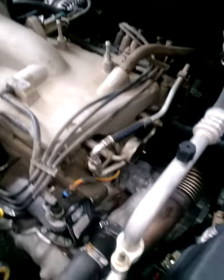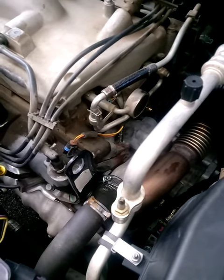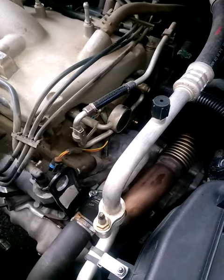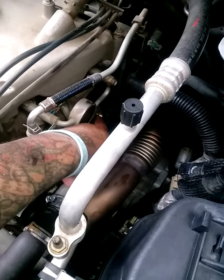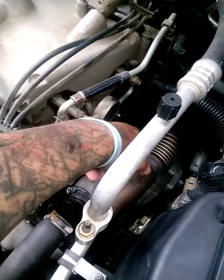The symptom is: when you go through a drive-thru or something the car rides normal while you're driving, sometimes the temperature eases up a little bit but usually goes back down. But when you're in a drive-thru and the temperature just starts to shoot up to where you have to pull out — there's a very good chance that is that sensor right there. Make sure the engine is pretty cool.